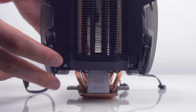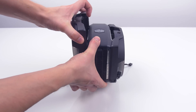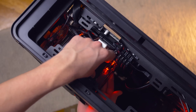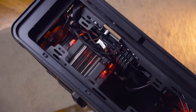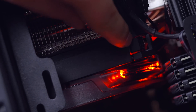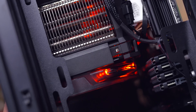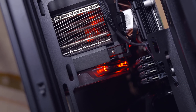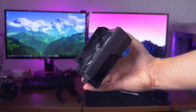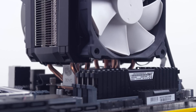The fans are mounted on brackets, so they are easily removable by pressing clips on each side. You need to remove the fans during installation, but it's not comfortable if you need to swap the fans inside the case, because these clips are at the base and may be difficult to access — especially if you have fans at the top or cannot remove the top panel at all. If you'd want to swap out the included fans, 120mm fan brackets are included, which grant you extra clearance for memory modules.